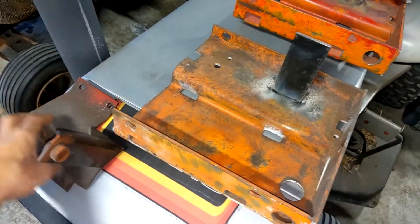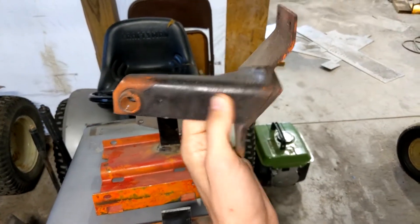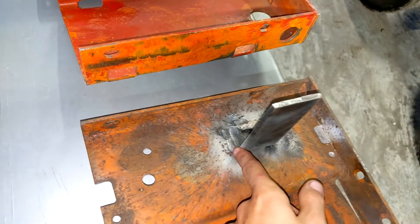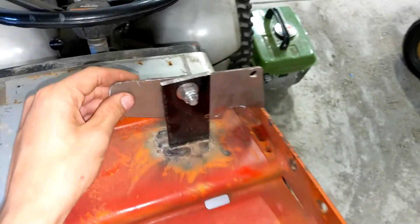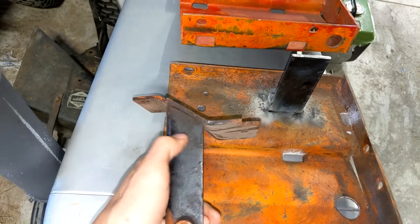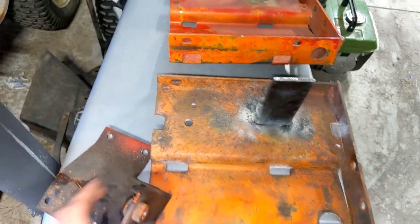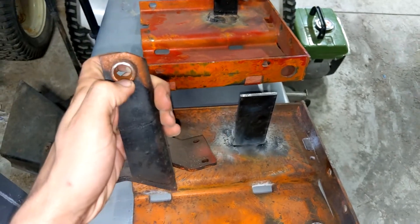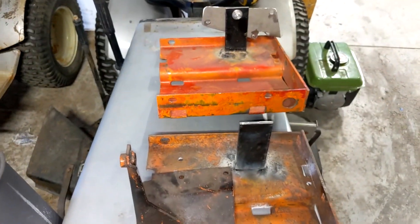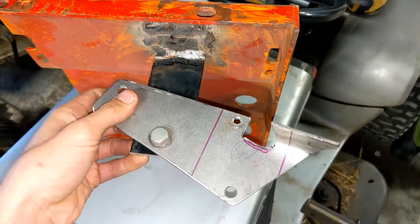The option I actually like the best is to take your factory clutch bracket — this goes on the side of the engine — and your clutch pivots right here. What you can do if you have this part is just cut it somewhere around here, weld that on the top of the battery tray, and keep your battery tray. You keep that bearing that's in there, and it basically works the same — it's making it like an ST16 style battery tray.